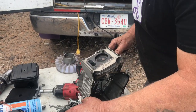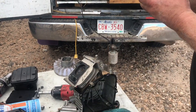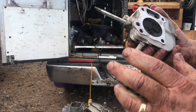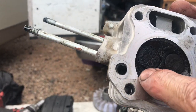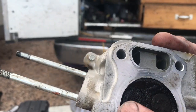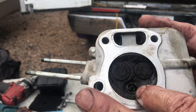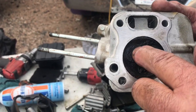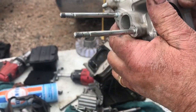This is the head, what it looks like from underneath. Look at those little baby valves! These ones haven't got a whole bunch of spring. Now when you notice - after the smoke cleared - see all the carbon buildup on here? It's been burning oil for a while. We ran it, we got our money out of it. That carbon buildup is caused from oil going in, getting fired and burning, and then sticking.